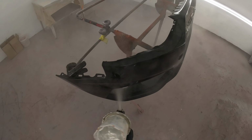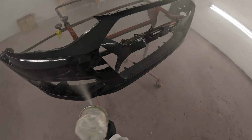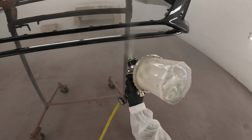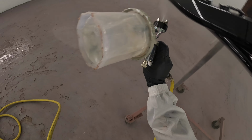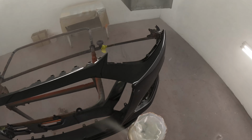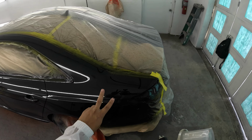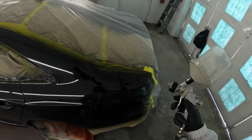I mean, unless you're spraying inside of an apartment down in the parking lot, which I doubt. If you're doing stuff at home, obviously you have a house. And if you have a house, you have 220 volt. And you can do this. Get a bigger compressor with the plug, get the pigtail that goes on the back of your dryer or the stove, and plug it in and run a big boy. But this is worth it, man, to put out professional looking work with a gun like this.